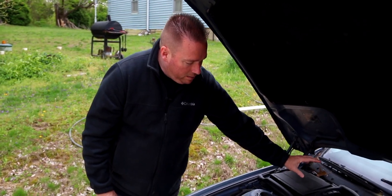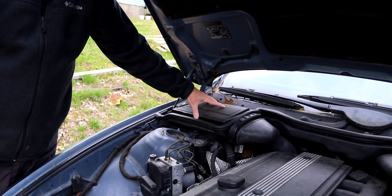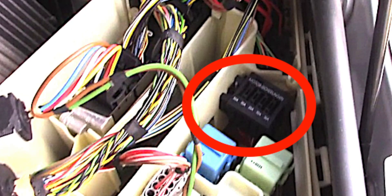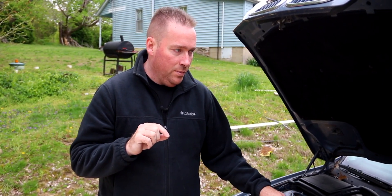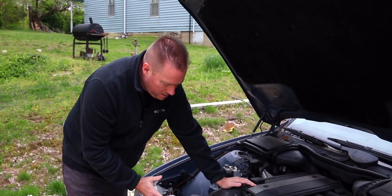That whole system is also linked to back here — the ECU lays under this piece. Next to the ECU there's a little five-fuse holder. A lot of times, if you're messing around with coil packs or having any kind of problem, it'll blow one of those fuses, and that'll give you crank but no start.